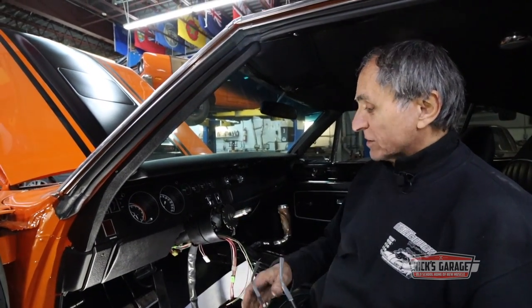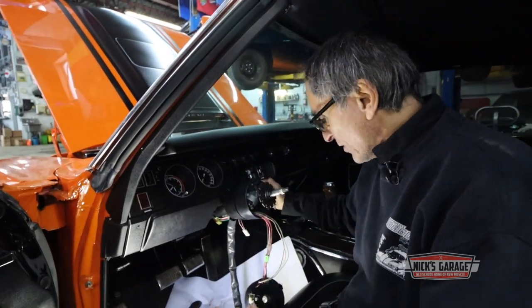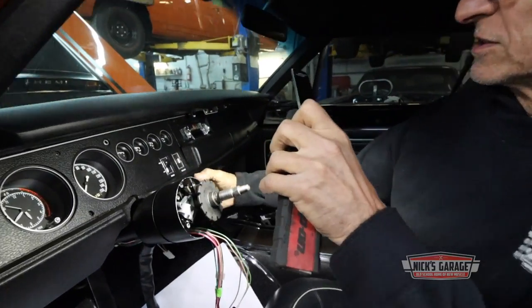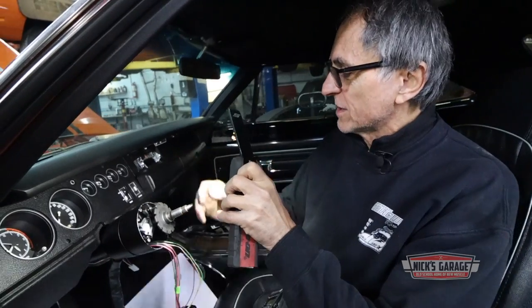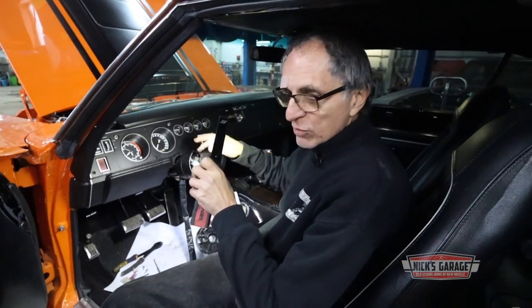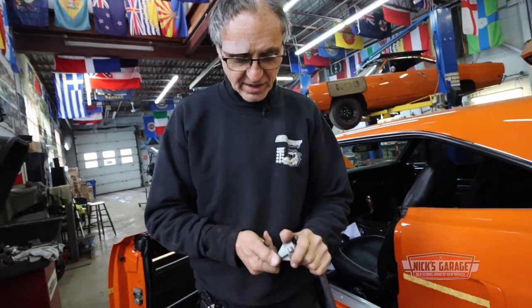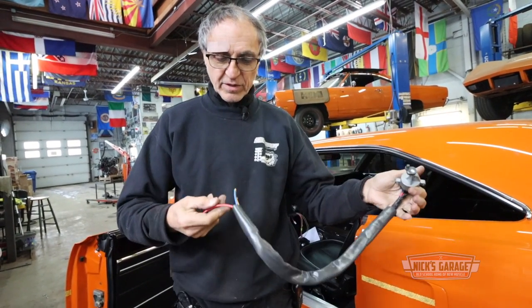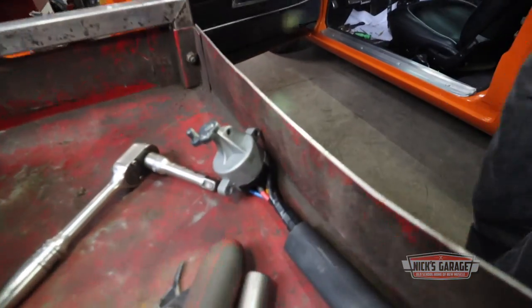We've got Gaetan's Road Runner finished and running, but we ran into a little problem — it didn't want to crank over. I found out the switch is not working, so I have to replace the ignition switch. To do that, I need to pull out the key cylinder — you push the pin inside and pull it out — but it came out only half an inch and stopped. I need to replace the switch that provides current through the yellow wire to the starter relay that cranks the starter over, and right now it's not working.